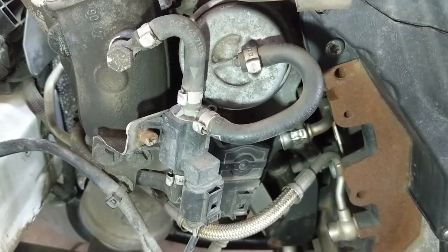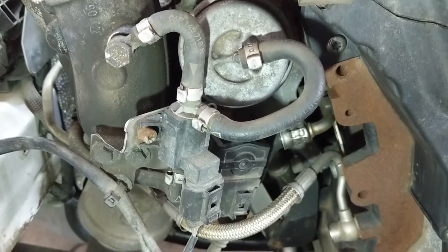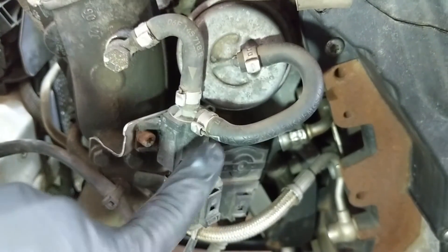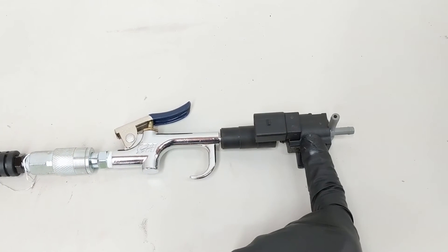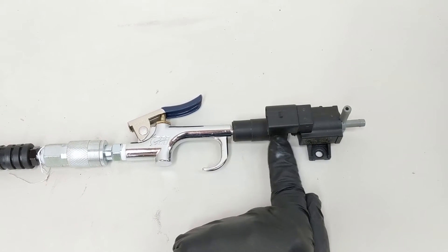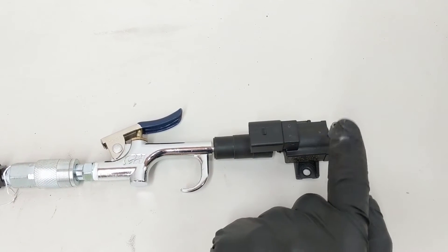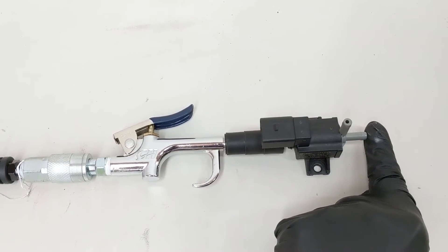In the default off, unpowered, or 0% duty cycle state, all air pressure coming in from the boost source is directed towards the wastegate actuator line. Here's a simple bench test of this state, with no power being supplied to the valve and about 15 psi of air coming in through the boost intake stem. This fitting isn't airtight so you'll hear a little bit of leaking, but what you'll find is that the only air exit path is through the wastegate actuator line, and covering and uncovering the air return line has no effect.